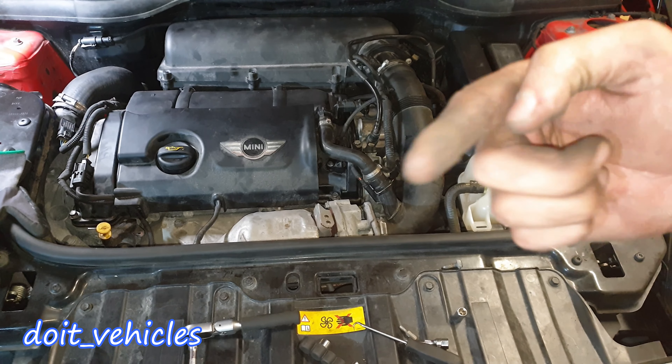From this point you can begin to see some components — like the electric power steering motor and the knock sensor. With an 8mm socket, go ahead and remove the manifold absolute pressure sensor and unplug the connector. This sensor is quite similar to the mass airflow sensor, measuring pressure inside the intake hose. This engine actually has 2 manifold absolute pressure sensors, which is quite common for a turbocharged or supercharged engine. The difference is that this one also includes the intake air temperature sensor, which is why it has 4 wires instead of 3.